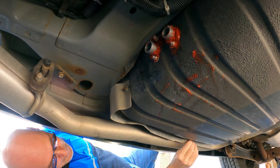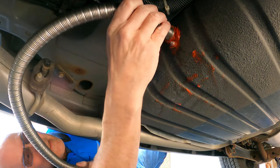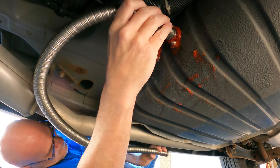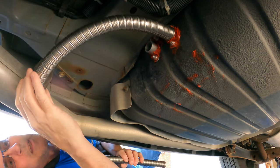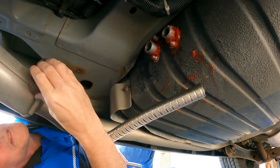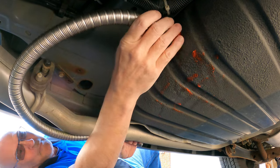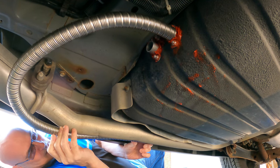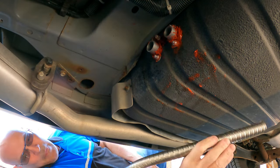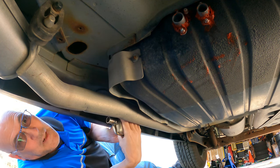and mount the exhaust down over here. And I think there's enough. Let me just practice with it. Yeah, okay. So that'll be fine and comfortable. What is this? Vibration mount. Okay. So yeah, that'll work. Bring that exhaust and just bring it with the pipe here, and we can put the exhaust for the diesel heater anywhere over here. So that'll be good. I'm going to take some bend out of this mount, and then I can probably put it right here, and that will hold the muffler perfectly in a spot we can use.